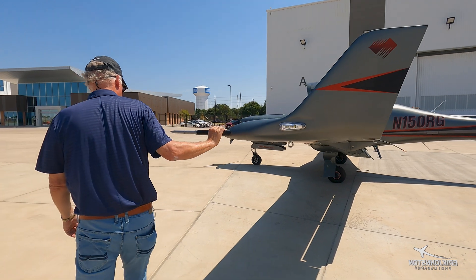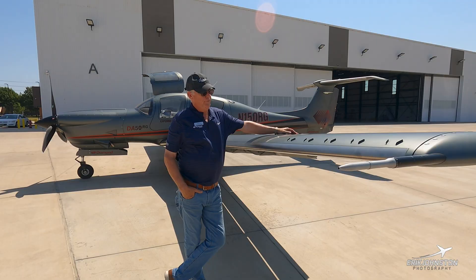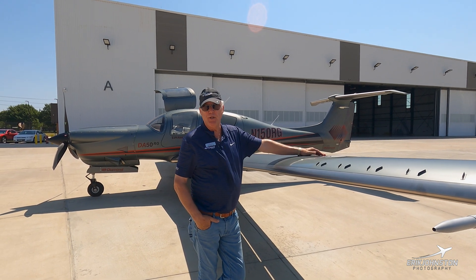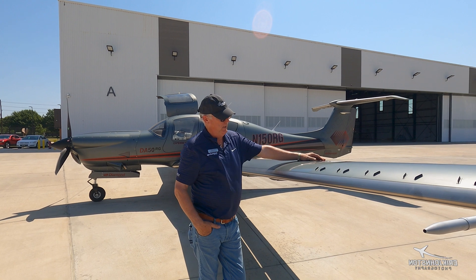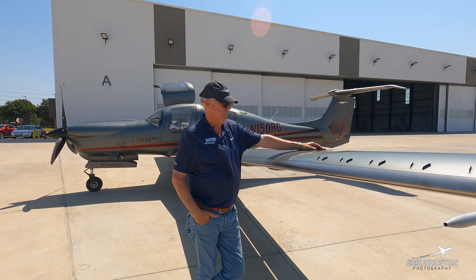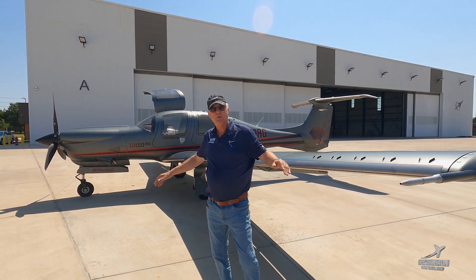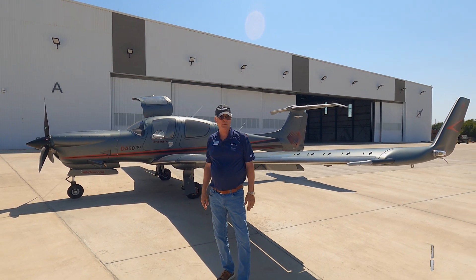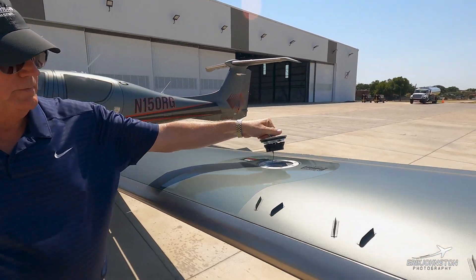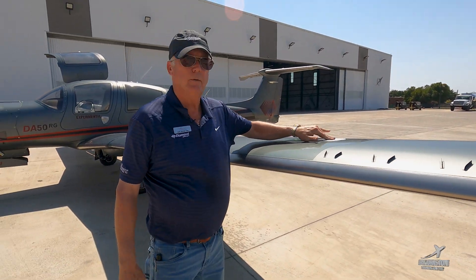We'll talk about the fuel tanks — 50 gallon capacity of Jet-A. The fuel is carried between twin spars along the axis, so there are really no CG changes as you fly off fuel in the DA-50RG. It's in metal fuel tanks with flex interconnects between the tanks, not unlike an airliner installation. The wings, back to the sailplane reference, give quite a bit of flex in turbulence, which creates a very smooth ride for the pilot and occupants. Jet-A is a very stable, very safe fuel, and in some places a little less expensive than 100LL.